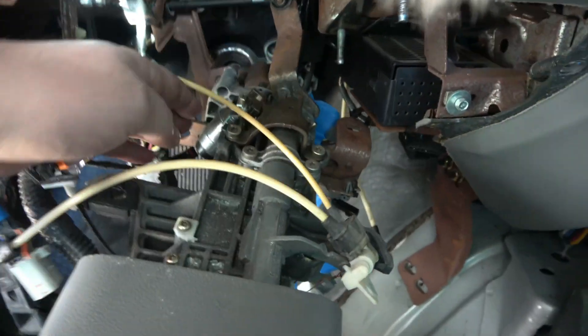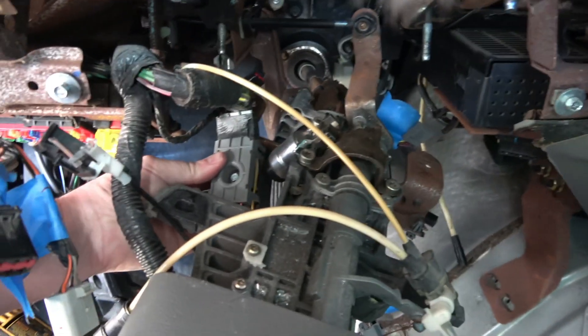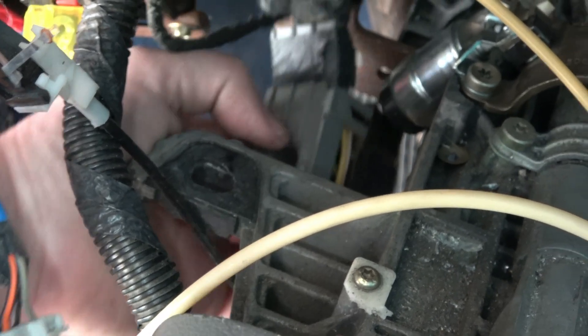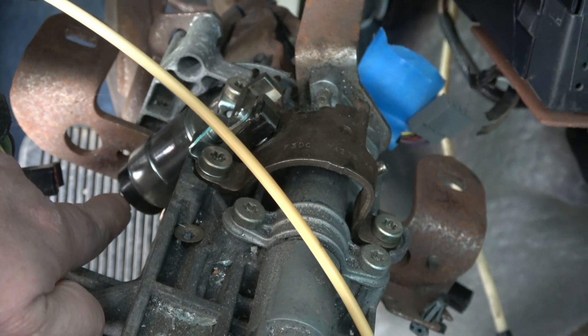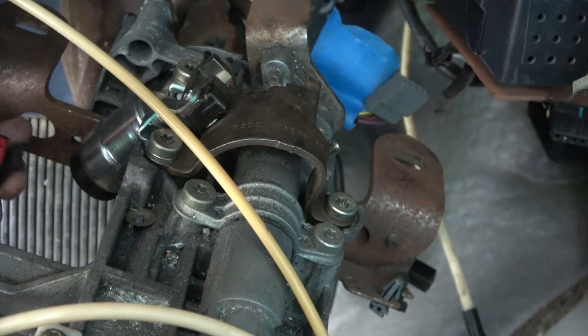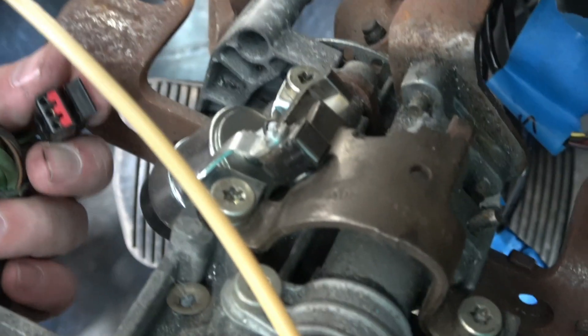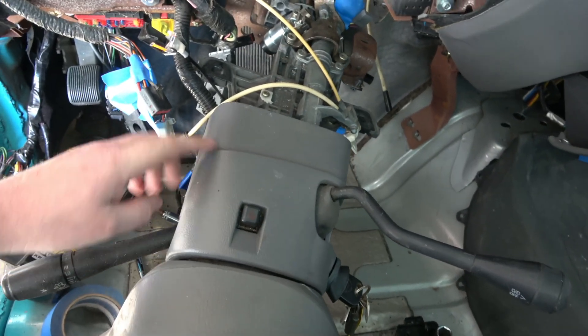In order to do that, you'll have to disconnect a couple of wires on the bottom side before you even unbolt anything. All these wires here, you'll have to disconnect those. Make sure you label everything. And then there is a junction box — let me see if I can zoom in on that — right here that bolts into the side of the steering column. The first time I took this apart, I broke this because I couldn't figure out how to unhook the wire coming into the back of it. I thought the whole black piece right here came off. That is not the case. Here is the black piece that goes into it — pull this part here up and it should pop right out.